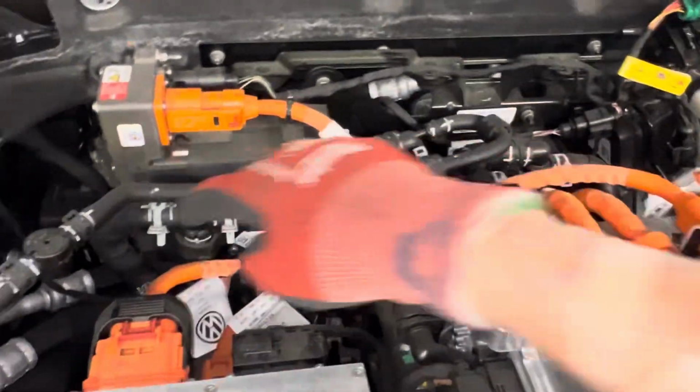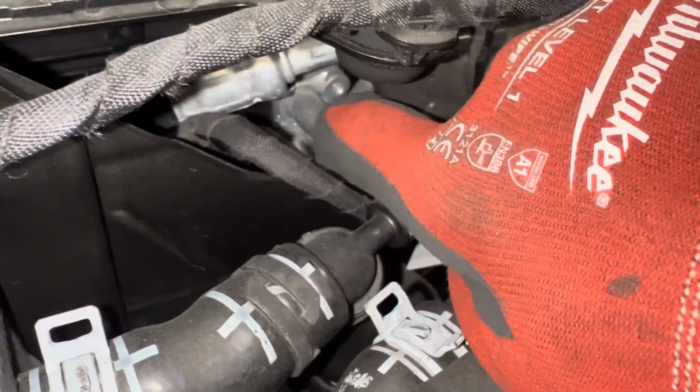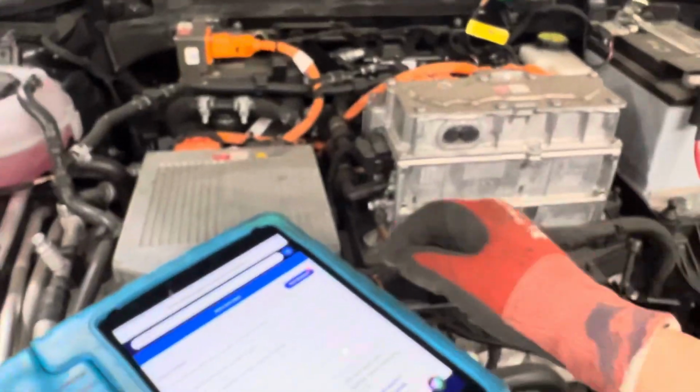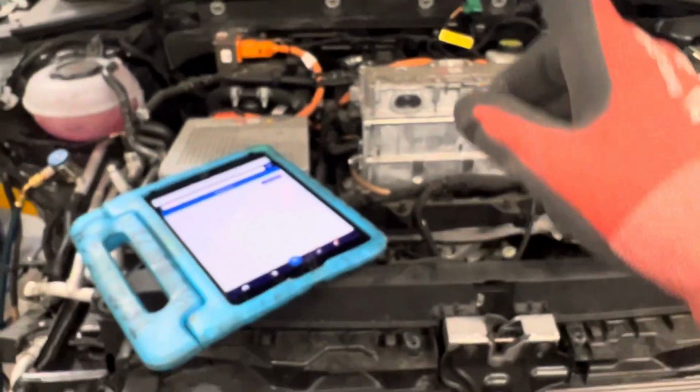But this line that's damaged goes right back here, it goes way back here, this one right here. It goes behind all this. All this has to be removed because that line connects behind this plate and everything way back there at the expansion valve, right where my fingertip is. It goes in right there. So the coolant draining and all this has to be done. And guys, you better start looking up your coolant draining procedures.